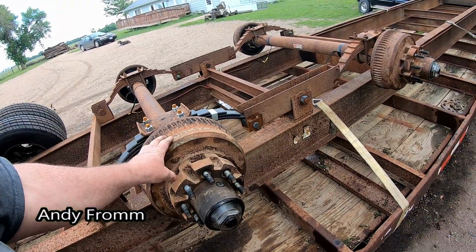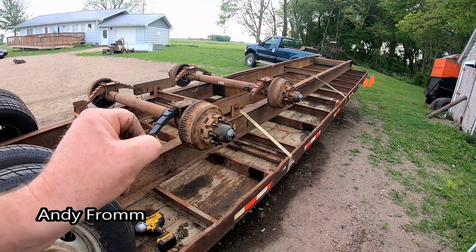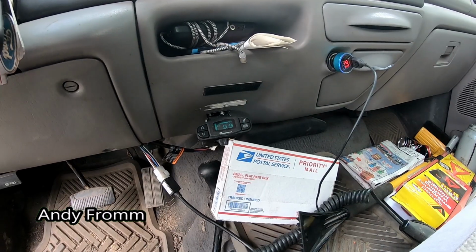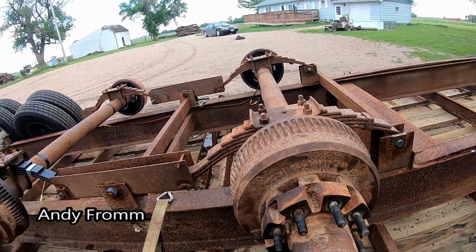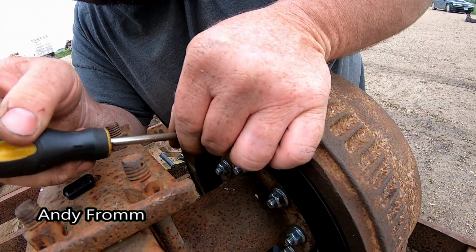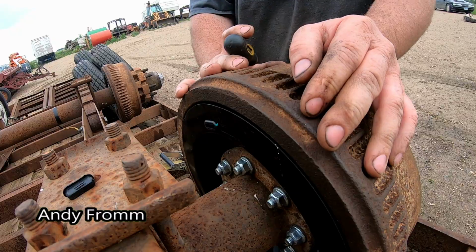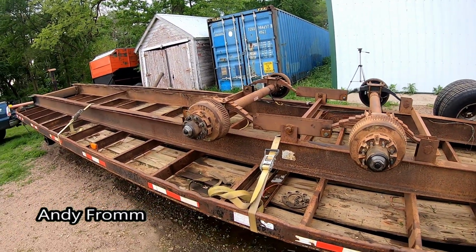And I want to do a little check on these things, make sure that they're actually energizing. So I got the pickup parked up there, hooked up. I'm gonna go pinch over the brake controller and see if these all hum. I heard some humming back there. That should hold it. Oh, looks like I gotta set these up a ways. I'll just do that 3 more times. Well, everything's hooked up and working. One last thing to do to this thing before it can be flopped over.